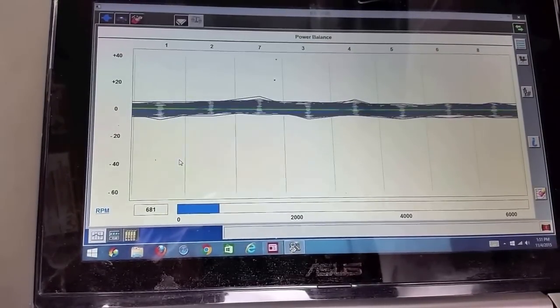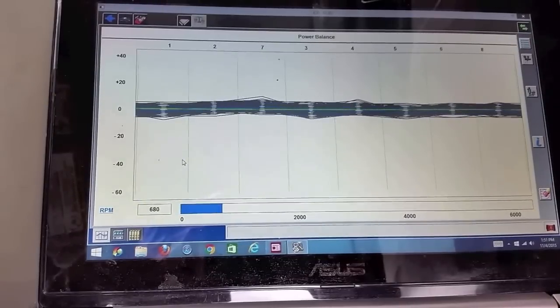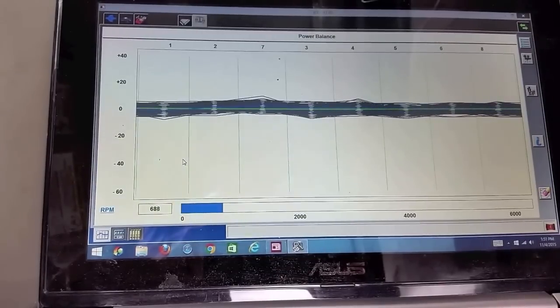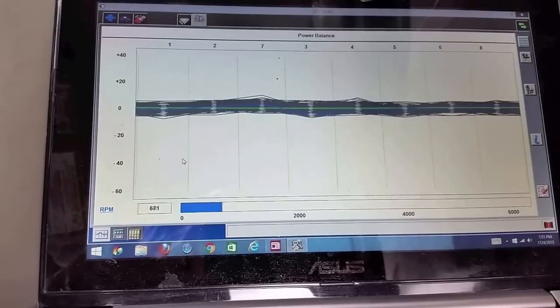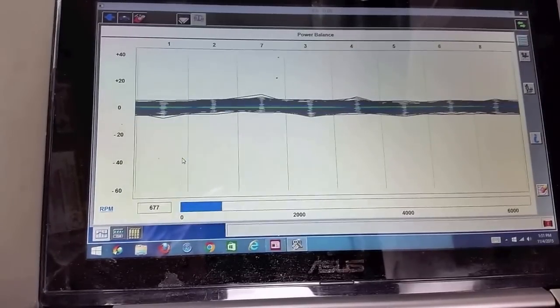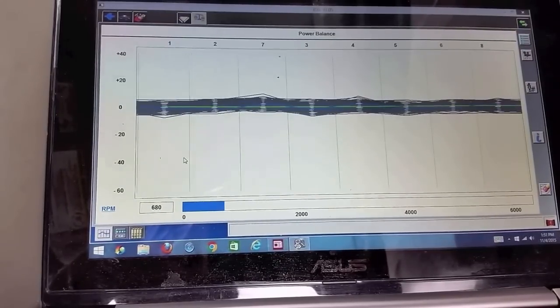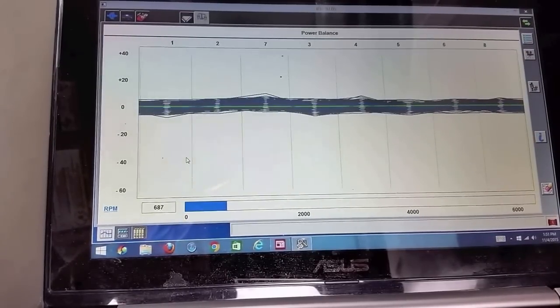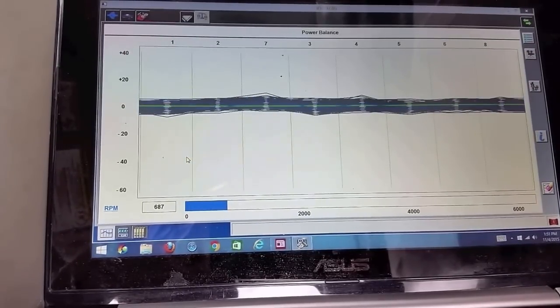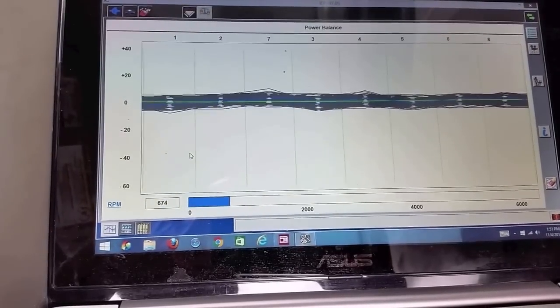Here we have it all back together. Monitoring the cylinder contribution — I have no problems with the injector that I took apart and resealed. The sleeve made absolutely no difference in the performance. I don't see any cylinders dripping or dropping or any other issues, including when I was driving it, so everything turned out good. I'm going to make a video on how to flush when you have a contaminated cooling system, with some pointers on that. Hopefully this gives you an alternative to replacing a cracked cylinder head. If you like my videos, please like and subscribe — thank you very much.